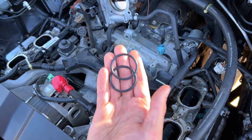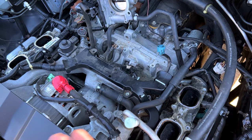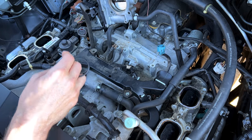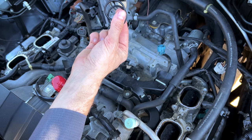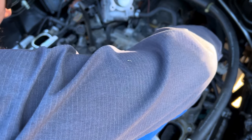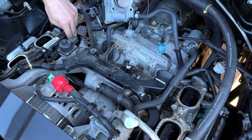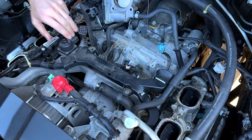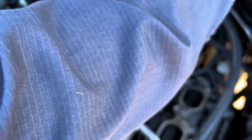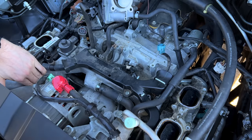All right, have those four bolts out now. These are our new O-rings — should be part number 806-933-010. So we're going to try to gently pull up on this crossover pipe and get it up just high enough where we can reach under there, pull out the old failed O-rings, and put the new ones in. Looks like we really have just enough wiggle room to get under here. You might want to take a long pick and just grab that old O-ring out of there — just be careful not to scratch the sealing surface when you do so.